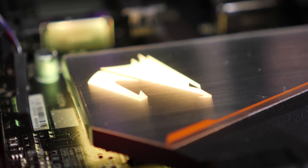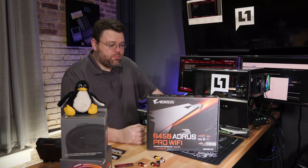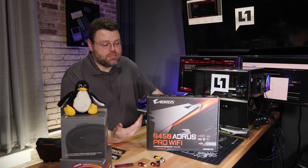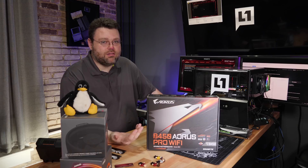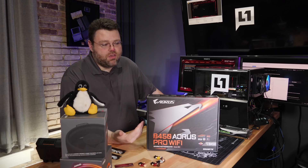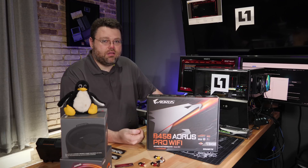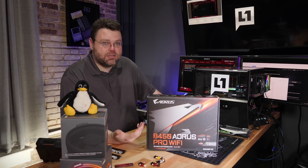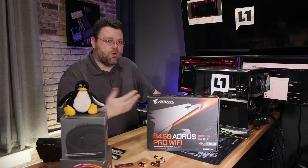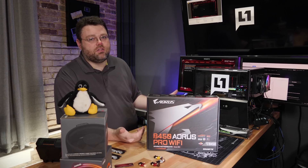In conclusion, is there any reason not to buy this motherboard because of the VRM kerfuffle? Gigabyte has corrected their website to reflect accurate specs — it's actually a four-plus-three configuration, which is better than what they were advertising, since more components theoretically improves longevity. A simpler VRM overall might have been a better design, but in terms of other features — higher-end audio, higher-end LAN, better PCB for memory speed — this board punches above its weight. Some of those features are normally reserved for X470, but the overall verdict is it's pretty good.